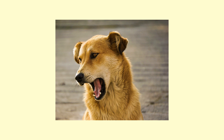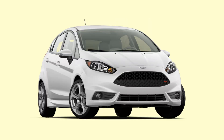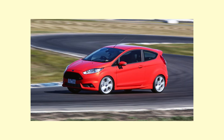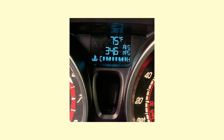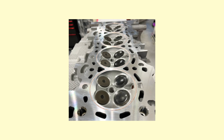With the technical details of the engine covered, let's talk about the changes made to the EcoBoost 1.6 over the Fiesta ST's life cycle. First up, the cylinder head. Whilst this is quite a robust design from the factory, the Fiesta ST is known to suffer from overheating issues on track — one owner even ended up cracking the cylinder head running a bigger turbo and possibly meth injection. With this overheating leading to a cracked block and subsequent oil leak in mind, Ford made changes for 2016 by modifying the coolant passageways so there's no hot spot in the cylinder head causing engine failure.